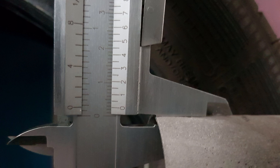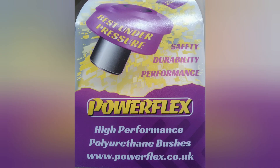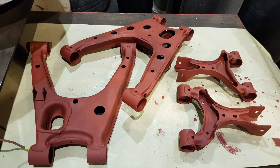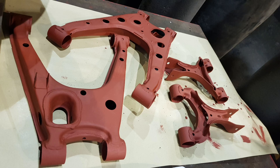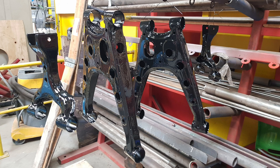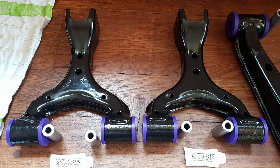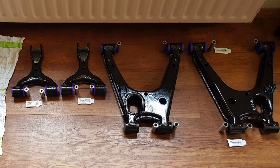After sandblasting the same holder on the opposite side of the car, I measured it to see how much loss of material there was due to the corrosion and test fitted my new Powerflex polyurethane suspension bush to see if there was any play — and there was none. So I decided the swing arms would be good for another round. I sandblasted all four of them and gave them an anti-rust coating before they were painted in the company spray booth by the company painter. I thought he really did a nice job on them and I was really pleased with the way they turned out.